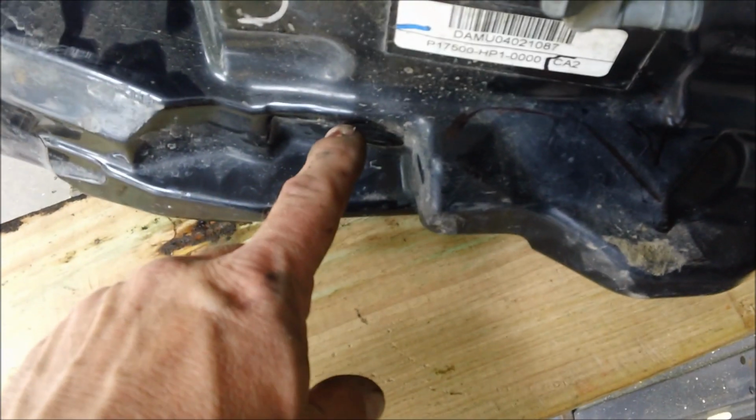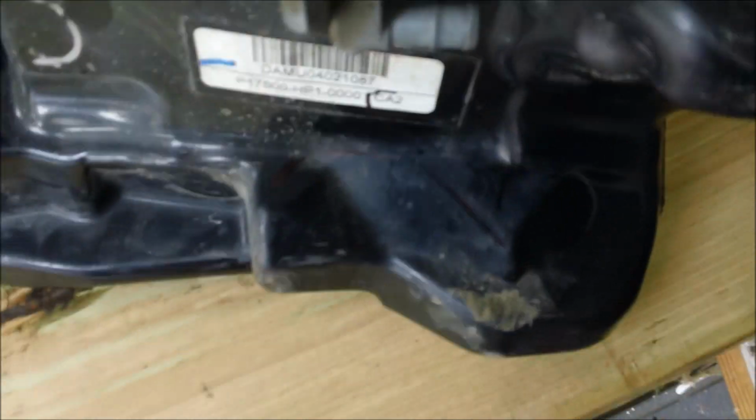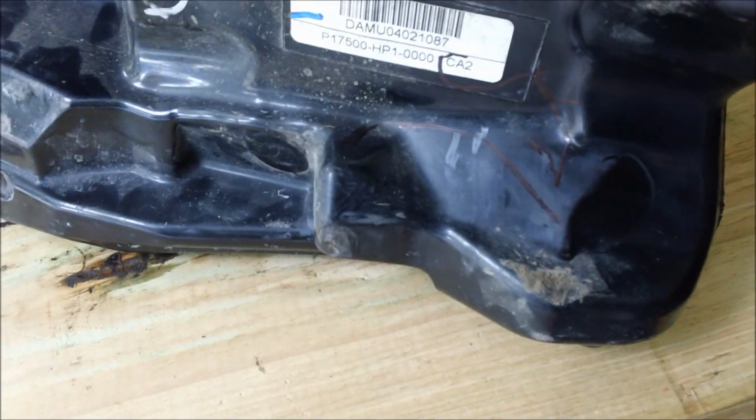Alright, here we are back again. So you can probably see I made the outline of the carburetor. I mounted the front screws in, pushed down on the tank, and surprisingly, this pad here is probably a 1/4 inch away when the new carb is in. So I put a highlighter in and just marked this general area where we're going to heat it up, and then make some more clearance. So kind of away and thinner down is the area. I haven't really done this part before, so we're going to give it a shot with the heat gun and see what happens.